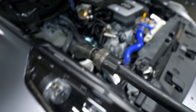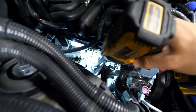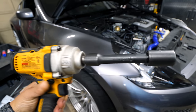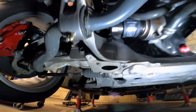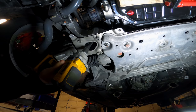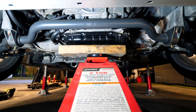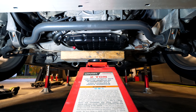Using a universal joint, a 14 millimeter socket, a long extension, and an impact gun, slide down over the stud for the upper portion of the mount and zap it off. The lower one is even easier — using the same impact gun, a smaller extension, and a 17 mil half-inch socket, go underneath the car and remove the lower bolt. Looking from the underside, locate the front lower control arm and just to the side you'll find the opening with the 17 millimeter lower engine mount nut. Remove the nut completely and keep track of it since you'll need it to install the new mounts. Repeat the same for the driver side engine mount.